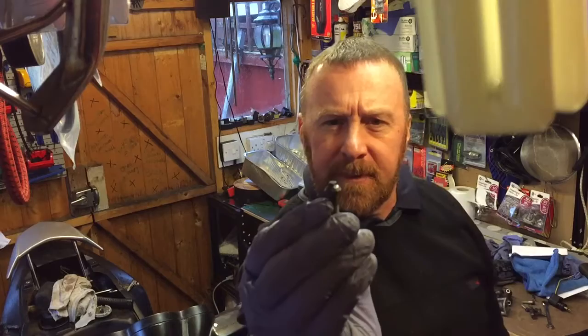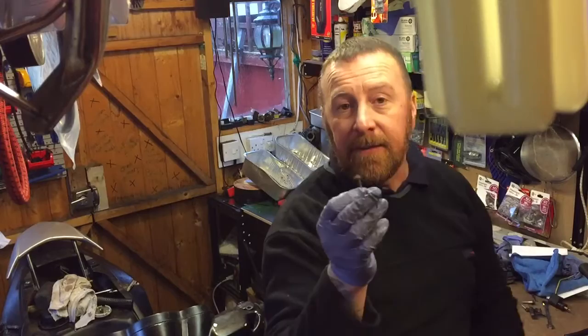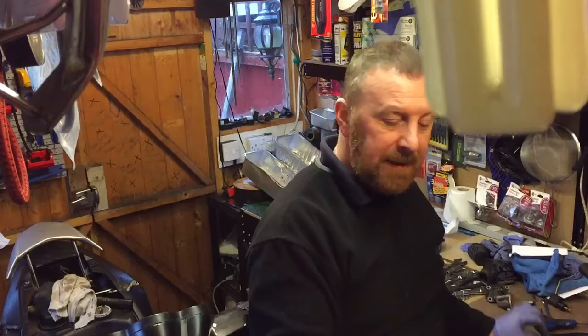See that, guys? Then, that's why I had the large screwdriver out: pop it in, hammer, bang it as hard as you can, and it'll stick, and it'll just twist out. As soon as that's loose, away you go. Get the other three out first, and then it becomes loose anyway, and when that comes off, you can either keep winding it out or use a small pair of pliers. Don't worry about it, chuck it away, find another 8mm bolt. I'm sure you have some in your shed somewhere looking like that. Okay, that's the top tip for how to get this little bugger out.